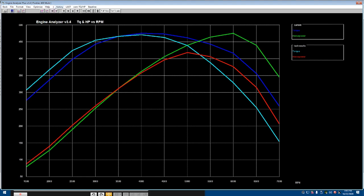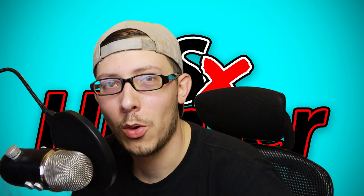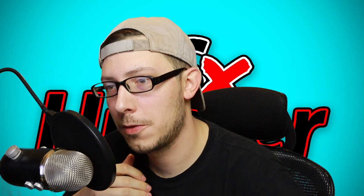Let's save this so we have a back-to-back comparison. Let's talk quickly about why and how I pick a cam for this engine. I know my heads flow 255 at 0.6 — that's a pretty big jump from 0.5 to 0.6. So if 0.5 was 246 and 0.6 was like 250, I wouldn't care. Getting to that full 0.6 is not a big deal to me. But we want to make sure that we're going to get our peak when we can. So we want to go to a high lift cam, and we want a fairly high lift cam for the exhaust as well — you can see the way it evacuates is significantly better than before.